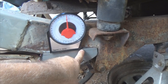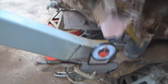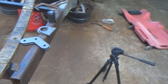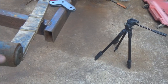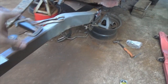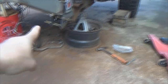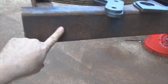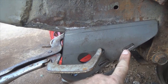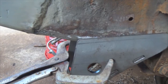I took my angle finder, zeroed it out to this top surface — zero degrees. I pulled the XJ springs, Jeep Cherokee XJ. After I got them out, I measured on the frame of the Jeep Cherokee center to center of the eyes — 51 inches from center to center. So measuring from the center of this to back here, 51 inches, to see where these tabs are going to fall. I got my welder to tack these right here in place on the ends to hold the width, then pulled them off and burned the weld in.